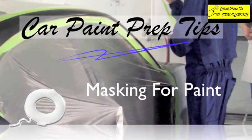Then they also make a special tape for this. It's just a thin piece of plastic tape, and in the center it has adhesive. And then on each side of that adhesive is just a piece of plastic which provides a real smooth line, where the paint doesn't make a real hard edge. And you can use a couple of layers of this along the jambs. You can put a coat on, peel the first layer off, put the second coat on, and then you can kind of layer it that way to where you can almost make an invisible line with this. I mean, it works real well.